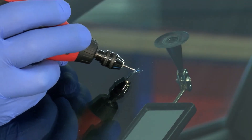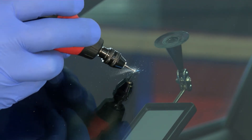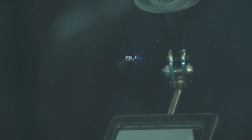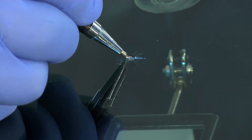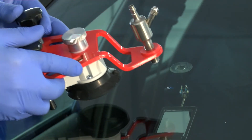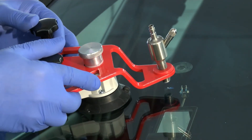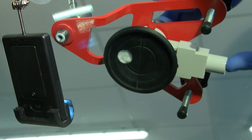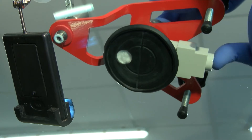When doing a repair on a star break or combo, it is recommended to drill the pit of the impact using the battery-powered drill. Clean the drilling residues with the carbide tip only at the point of impact. Position the injection bridge at the impact so that its injection head is centered on the impact point. Pump the plunger to secure the bridge.